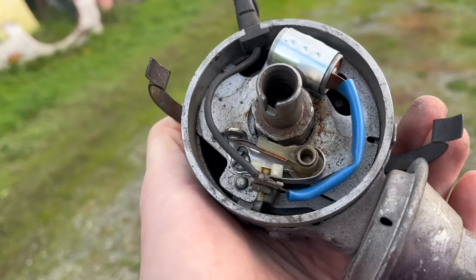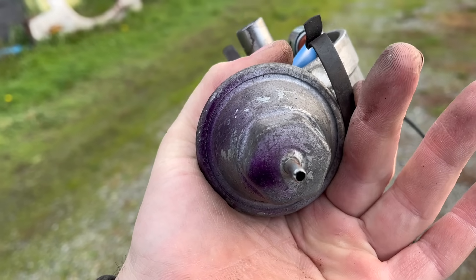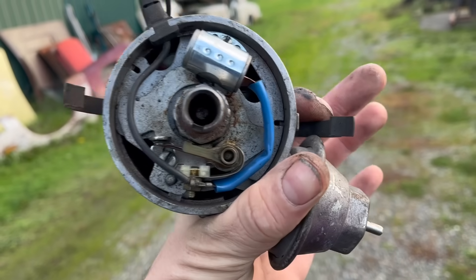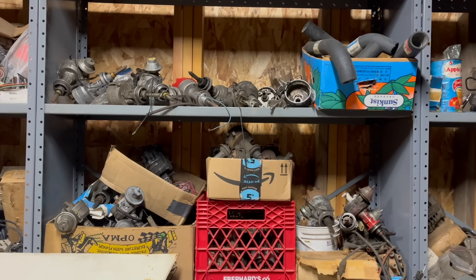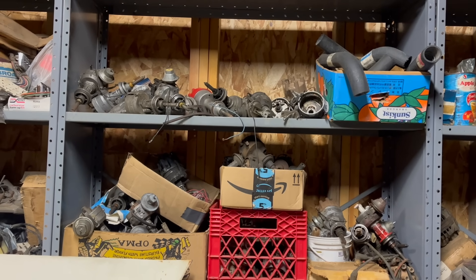Shiny new tune-up parts — I installed those on the side of the road in Montana. I just noticed something really funny about this: the vacuum advance pod is bad, too. That means there was absolutely zero advance from this unit and a vacuum leak. Time once again for one of my favorite activities: shopping for parts in the back building at Rocket.